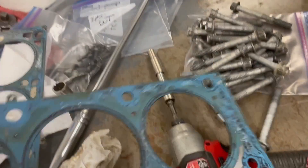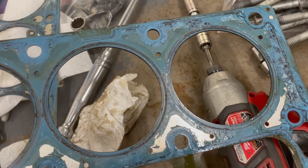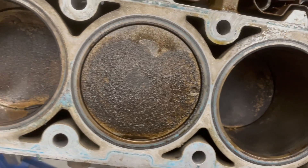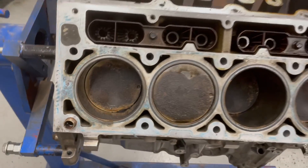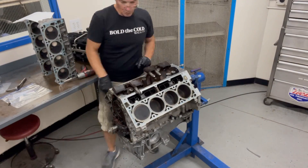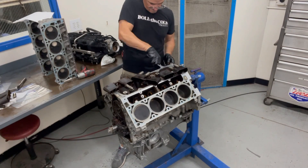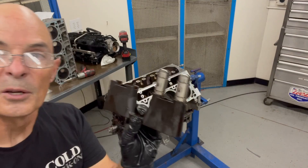I'll take a look at the edges to see if it's ready to blow a head gasket. Now let's pull the lifters out. You can see the ultra-long DoD lifters - they even have little guides to stop them from rotating. We replace these when we do a cam upgrade.